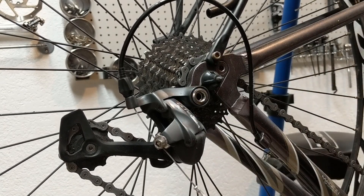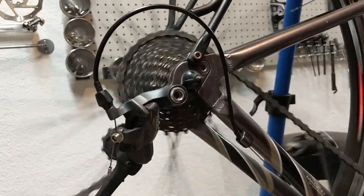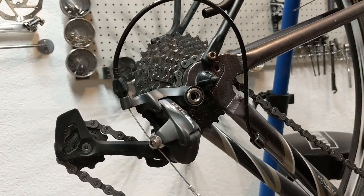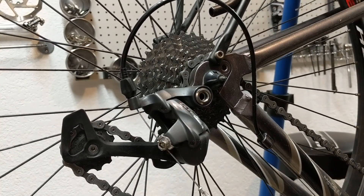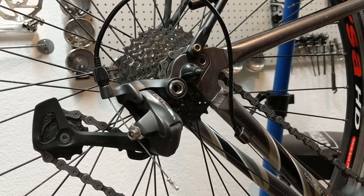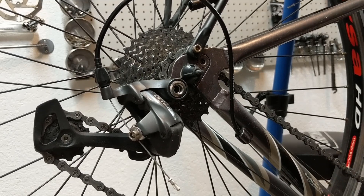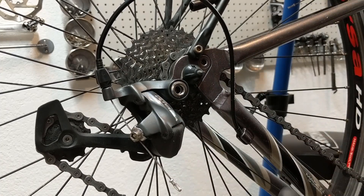The key is: can I get into the closest gear? And then can I still get into the furthest one if I pull on the cable? You can see I have the entire range of motion — so that's good. No other adjustments needed to the screws. Now that I have full range of motion, the main thing I'm concerned about is: can I make it through the gears? And if I can't, is the chain needing to go that way or this way?